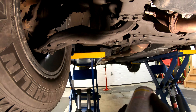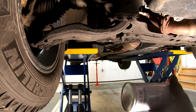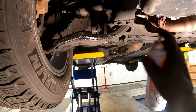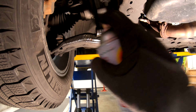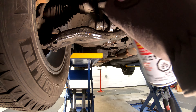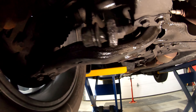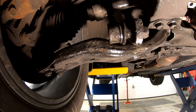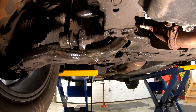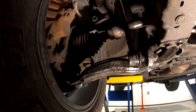Here's a quick demonstration with one of the cans. You give it a shake and basically you can just spray everything pretty liberally — you want to coat all the metal surfaces, the subframe, up into the suspension bits, all of that. You can see it just kind of leaves a little bit of a bubbly mess. Only the aerosols actually bubble; the bulk stuff from the gun doesn't bubble like that. Something about the aerosols does that — I've never figured out why, let me know in the comments below. You basically just coat everything with a light film of this stuff and that's all you need to do.